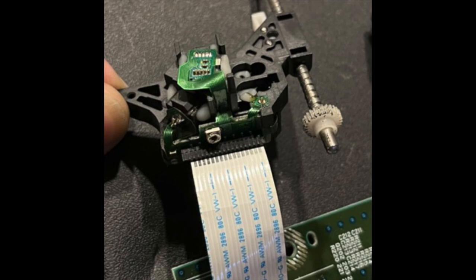We're almost ready to put everything back together. Our last step is to reconnect the ribbon cable from your GD-ROM board into the new laser — do this very carefully. The ribbon cable from the GD-ROM board only has 16 pins, while the slot on your new laser has 17 pins. That's not a big deal — just plug the ribbon cable as far to the right as you can, leaving the leftmost pin empty. As long as you do this, everything should work perfectly.